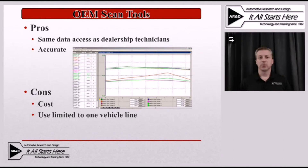The downside to a diagnostic scan tool from the manufacturer really comes down to the cost, which is definitely in many cases very high. Fortunately, some of the diagnostic tools are coming down in cost. In particular, manufacturers like Toyota and General Motors have made short-term subscriptions available using a J2534 interface, where you can purchase a 2-3 day subscription to the diagnostic software which will allow you to use your generic interface to access the vehicle using the same OEM level scan tool — without having to buy it as a long-term investment. The other downside to an OEM scan tool is that it's only designed for one platform, so if you make a large upfront investment, you have to be working on a lot of that particular car line in your shop in order to offset the high cost.